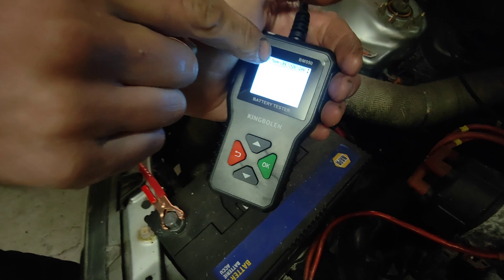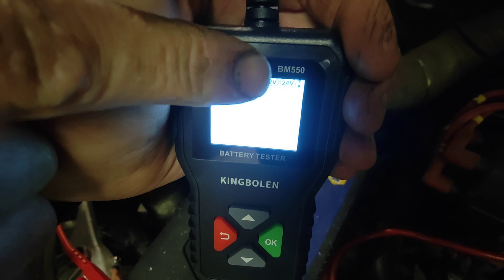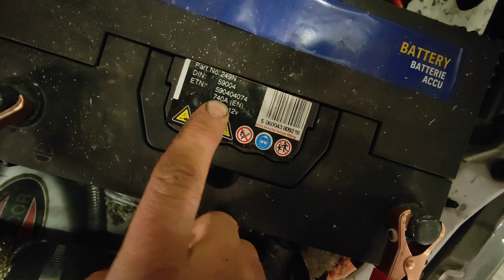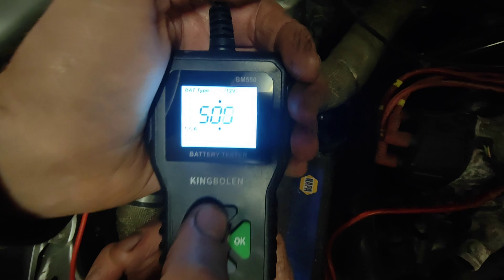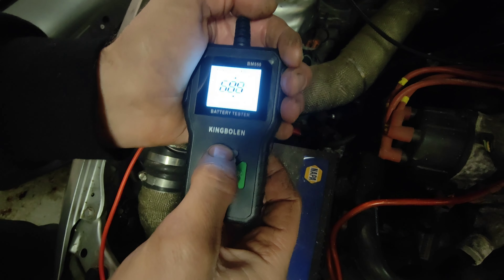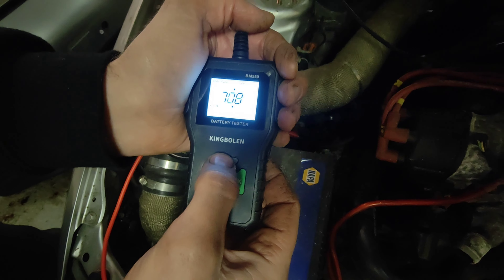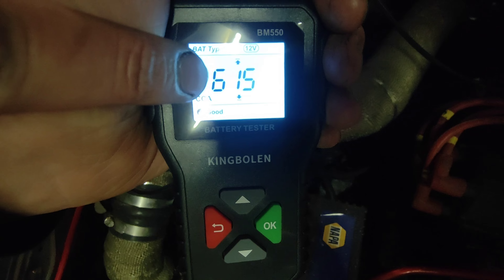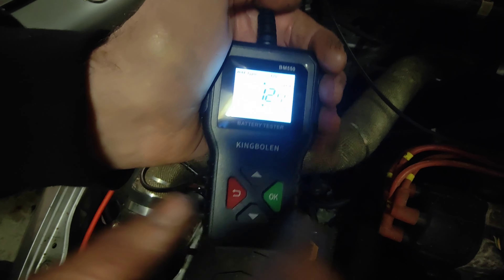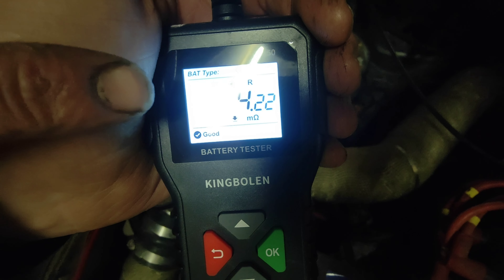At the top of the screen there's a 6, 12, and 24 volt selector and you can scroll through with the arrows — we're on 12 there. On the top of the battery you'll have your amperage; this one's a 740 amp battery, that's for your cold crank amps. We want to set it to 740. We've just charged this battery overnight and it's saying it's still good, but it's not at 740 amps — it has lost a little bit. We're on 615, but that's more than enough to start the car. We've got 12.55 volts, and then this is the battery's internal resistance.